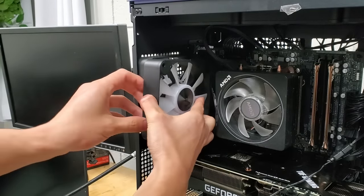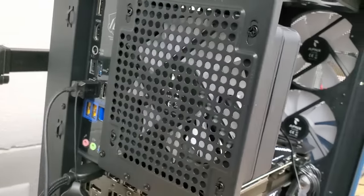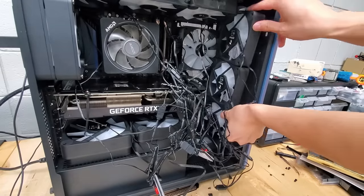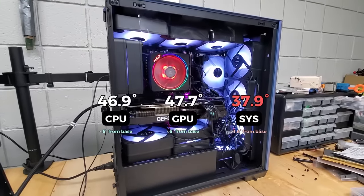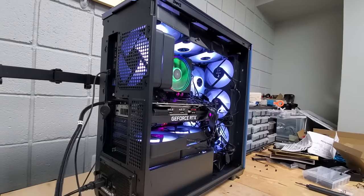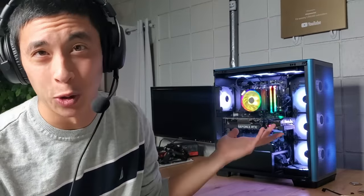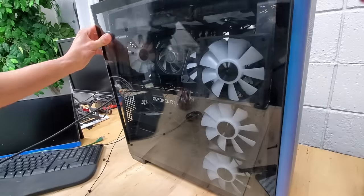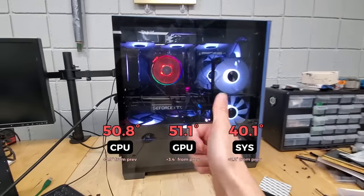But taking this test beyond just a CPU cooler, what happens if we install double-stacked fans throughout our entire PC case? Well, to find out, we can add an additional fan back here, two down below, one here as well, three up top, and three more along the backside. And yet, as we saw a bit earlier, this actually leads to worse performance than not having them at all. With this setup, we've created a bunch of airflow streams that collide into each other, likely creating even some warm pockets of air throughout the turbulence. So let's just shove every last fan we have into the case and see what happens — this ends up posting an even worse result than our previous test. All we really did was add more turbulence to the fire.